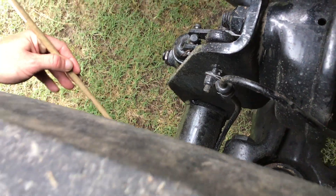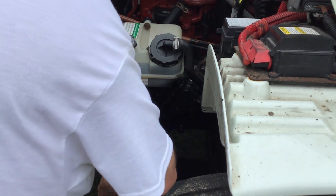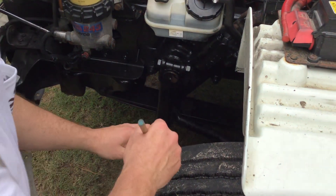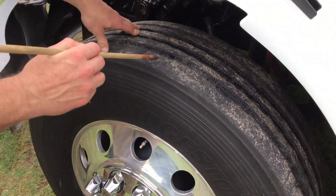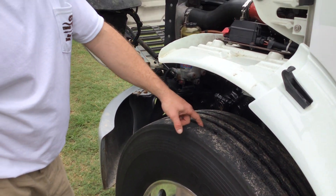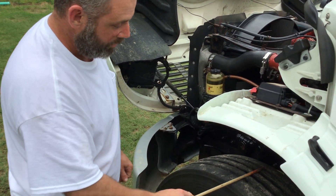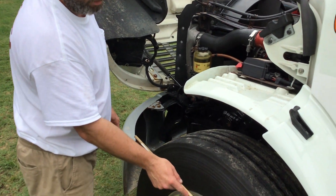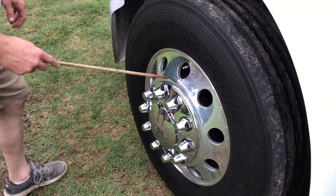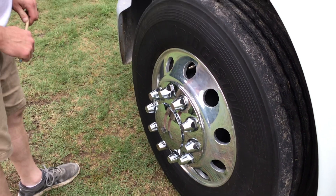From there, we'll go to the inner wheel. It's not cracked, bent, or broken — it's free from illegal welds. Next, we'll go to the inner tire wall. It has no abrasions, bulges, or cuts. It's properly mounted and seated to my wheel. Next, we'll work our way out on the tire. This must be identified as a virgin steer tire. It has more than 4/32nds of an inch tread depth — to check tread depth you'd use a tire tread depth gauge. The tire is evenly worn with no abrasions, bulges, or cuts. The outer tire wall has no abrasions, bulges, or cuts. It's properly seated to my outer wheel. My valve stem is properly mounted and secured. All nuts and bolts are present and tight. It's not cracked, bent, or broken, and it's not leaking.